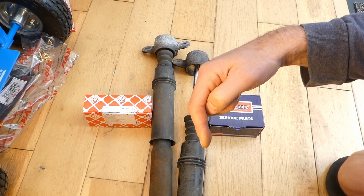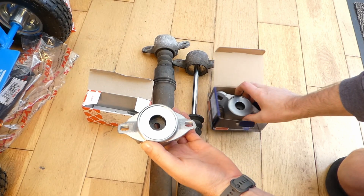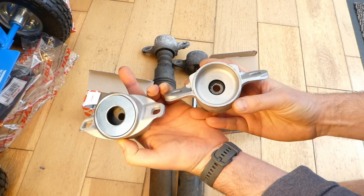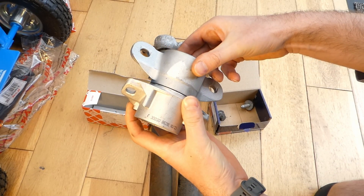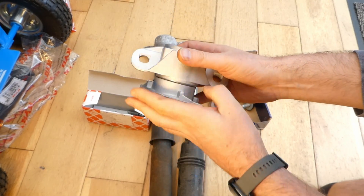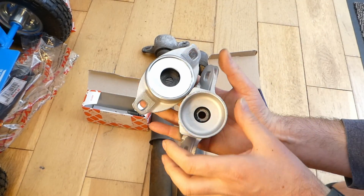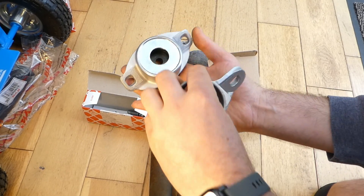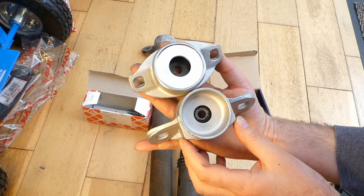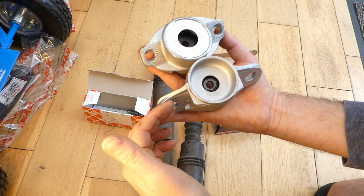All the components are in the description of the video. First of all, these are the two struts and they look kind of the same — the diameter is the same, the hole is the same, 10 millimeter hole — but they are not entirely the same. If you look at them like that, they look nearly identical apart from the pitch, which is turned slightly more on one than the other, and the distance of the bolts is much larger on one than the other.